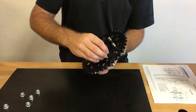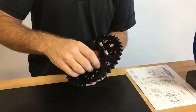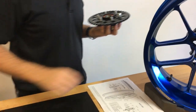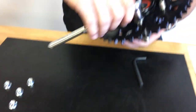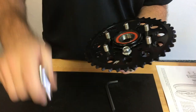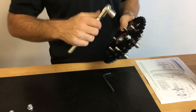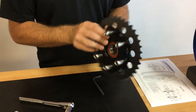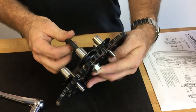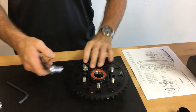Put the sprocket in place and hand tighten the sprocket nuts. It's a metal locking sprocket nut, so when it comes time to actually tighten it down, you're just going to use a ratchet to get past the tight portion of the locking mechanism and then tighten it down. If for some reason the stud starts to spin — which is not likely — you have an 8mm socket on the back. You can hold it with an 8mm Allen wrench and then finish tightening it down.